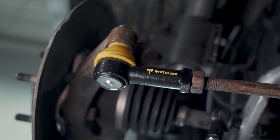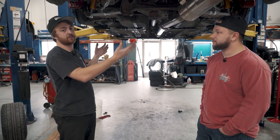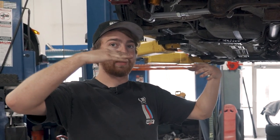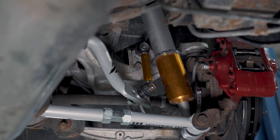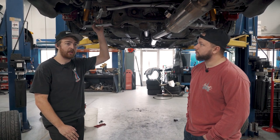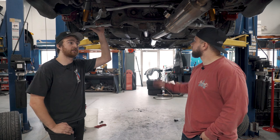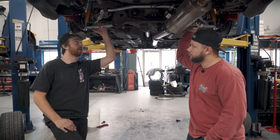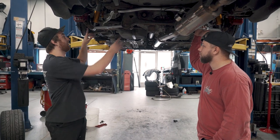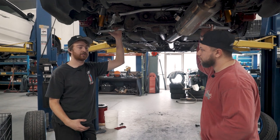What are some of the track benefits to doing this? Anti-roll bar and sway bar are the same piece — just a different term. When you call it an anti-roll bar, it gives you a better understanding of what it's doing: it's keeping the body of the car level as the suspension travels through a corner. Being able to fine tune that over stock is a huge advantage, because depending on track conditions and the rest of your suspension setup, this will dictate how you want to run your sway bar — whether you need it stiffer or looser to give you a little more roll or a little more squat. The big advantage is the adjustability. From the factory they use a concentric bolt and nut setup, and being able to just have a jam nut and a telescoping rod makes adjustments so much easier.